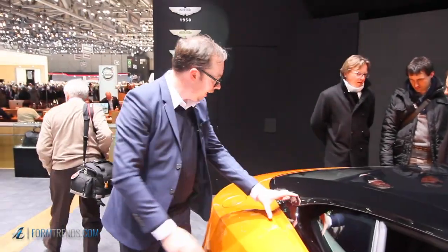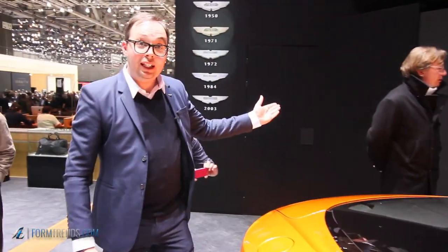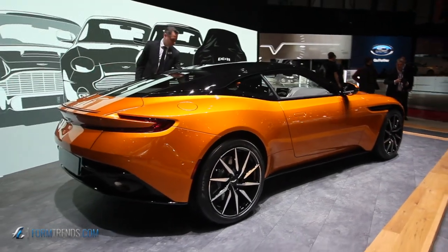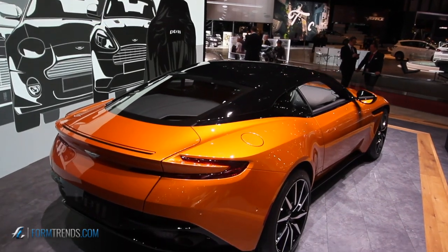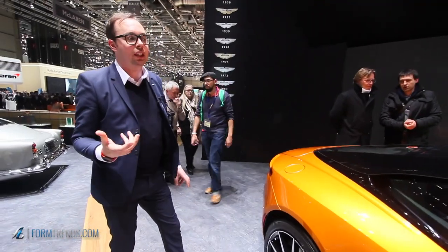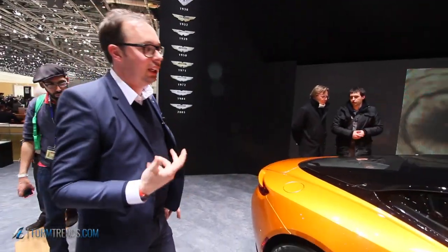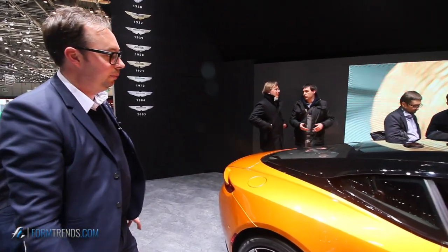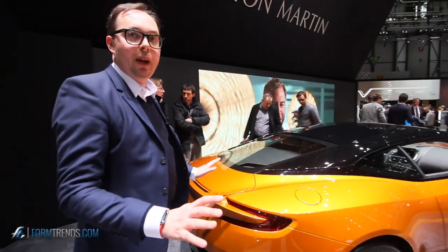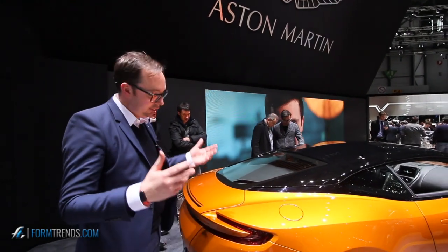This was inspired by the F-duct in Formula One, which is itself inspired by 1950s biplanes — blown wings. The air comes through here through a tunnel and creates a blade of air at the back of the car. The real reason for doing that is we wanted this super-clean silhouette on the back. Going back to the GT cars, the greats of the 40s, 50s, and 70s — they had really, really clean lines. The reason that changed is aerodynamics and high-speed requirements, and we wanted to find a solution that was unique and innovative. We actually have two patents on this system. It produces lots of high-speed stability and does that with almost no drag penalty whatsoever — a very clever system, hence the patent.